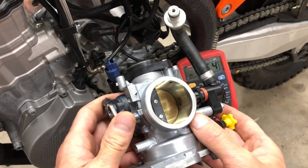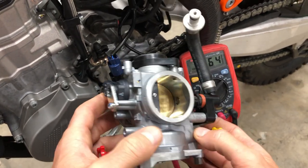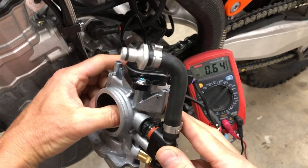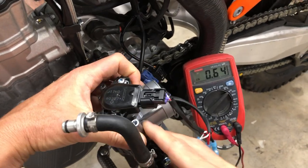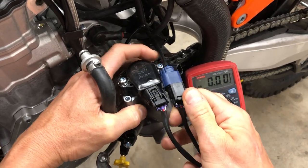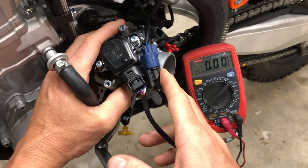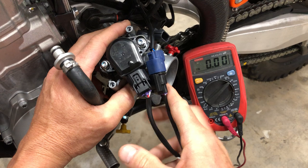And that is true, but it is not a tuning practice that will be effective through the whole throttle range, and your bike's just going to run lean. It just is. So again, just to debunk the myth that doing the TPS throttle hack is a fueling tuning method, it's completely not. And here's the thing, none of the tuners that are out there creating maps, creating value for the tuning community and the moto community, push that. Nobody. I know that in forums and there's videos that talk about that, but you're not seeing those suggestions from a lot of the guys that you know and respect.